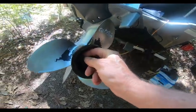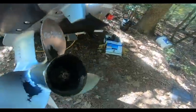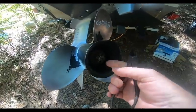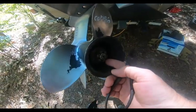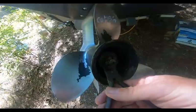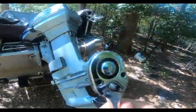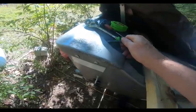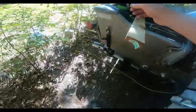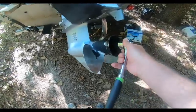You'll need to flatten out your cotter pin, which I've already taken off. To remove it easily, flatten the part that's turned up, put your cutting dykes in there, and then gently tap it out with your hammer. After doing that, you're going to need a 1 and 1/16 inch socket — they do make plastic floatable ones.